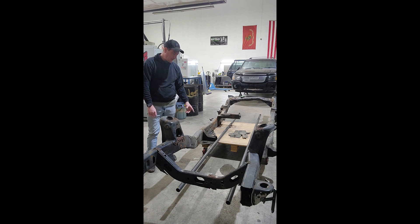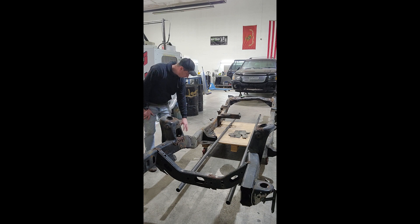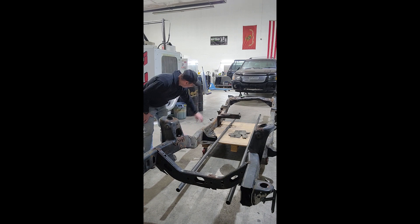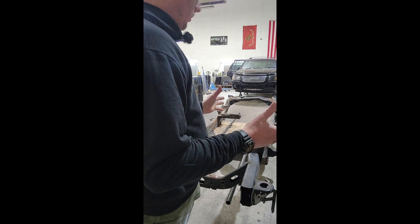I think I'll have enough room — I'm body-dropping it slightly. For the rocker bar I'm thinking of putting that bottom door bar flat on the inside. I can actually cope and notch through the body mounts since everything is real tight in there, and run it along the top. The main hoop and A-pillar bars will sit right on top of that, which is just a little easier to do. I'm pretty sure that's what's going to happen.